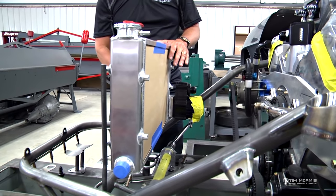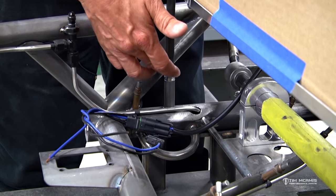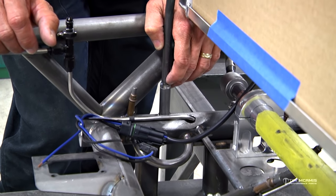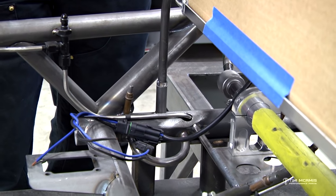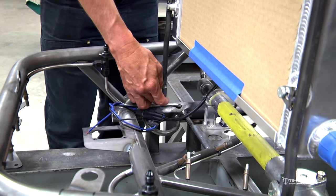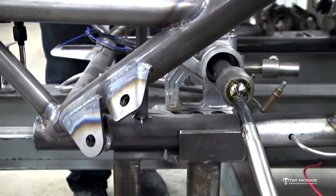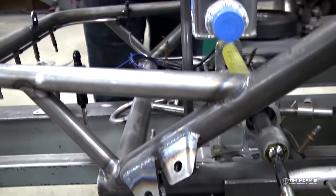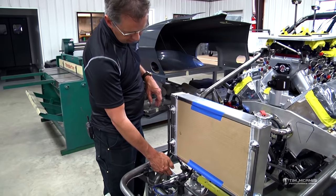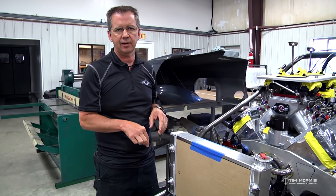So with the pump running we can bleed that off and get all that air out from this little petcock. This mount is done and there's a couple little sleeves — we're going to see a 5/8 inch 0.058 wall sleeve here, and this is half inch tubing. It comes with these two little stop sleeves which are about 3/8 of an inch thick. That's going to be tacked onto the main tube here so that when you set the radiator down in there it stops on those little welded stop sleeves. That way you can cut this mount — this mount doesn't have to go all the way to the bottom, because when you weld it down at the bottom it actually shrinks the tube a little bit and you can get some burn-through into the tube. So if the half inch tube goes all the way to the bottom they stick — they're sticky to get in and out. With these little stop sleeves you can cut that tube off about a half inch short from going all the way to the bottom, and then that radiator will slip in and out very easily.